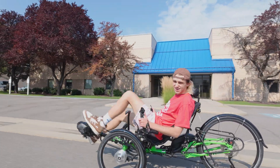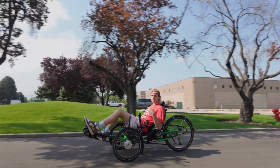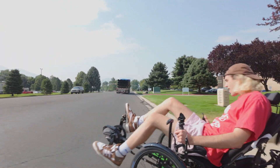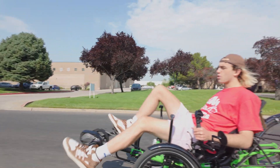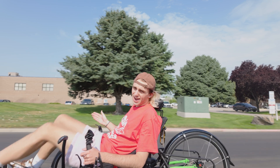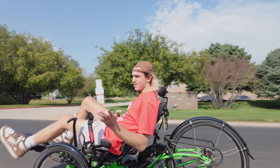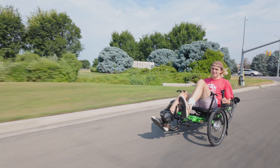Taking out a Shimano torque sensing motor this time. I haven't ridden too many Shimanos — I've really only ridden the Bosch Performance Line and Active Line — so I'm excited to try this one out today. Right off the bat, I'm already feeling the difference in the pedaling. The quality of this pedaling when you start off, compared to the cadence sensing motor, is night and day. On the other one, I was having a hard time getting going because the motor isn't kicking in right when I start — it's got to make a full revolution. But here, instantly I push and I'm already going.